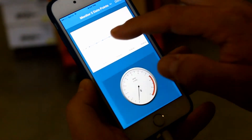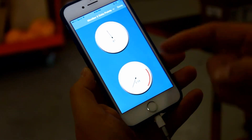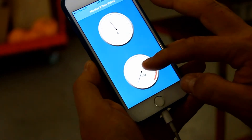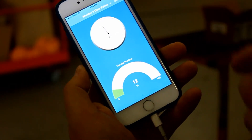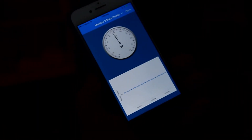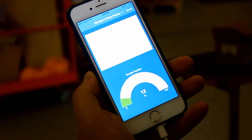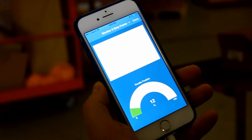I love how interactive that is. When we start up the car, you'll go ahead and see this stuff live. As you can see, we've got RPM down here. We've got intake air temp up there at about 87 degrees Fahrenheit. We can change the RPM here to throttle position — shows it there at about 12% at idle. You can throw this around and it would actually fluctuate. These are features that IPD is testing with Gluon and giving them feedback — all very exciting stuff for us and the consumer.